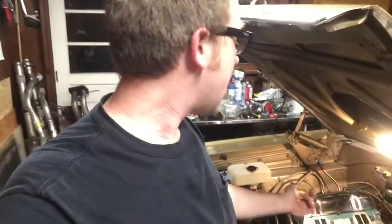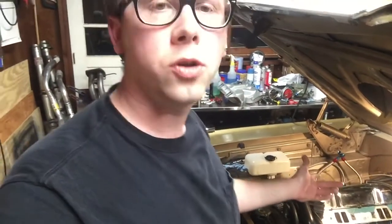Take your measurements, figure out if you're parallel or if you need to have the intake angle milled, and bring it to your machine shop. In my case, I told them I wanted seven thousandths off the top on both sides, so that put me fourteen thousandths the other way. Theoretically I should have six thousandths more pinch at the bottom when I get through all my measurements. Good luck — I hope you get those vacuum leaks fixed.